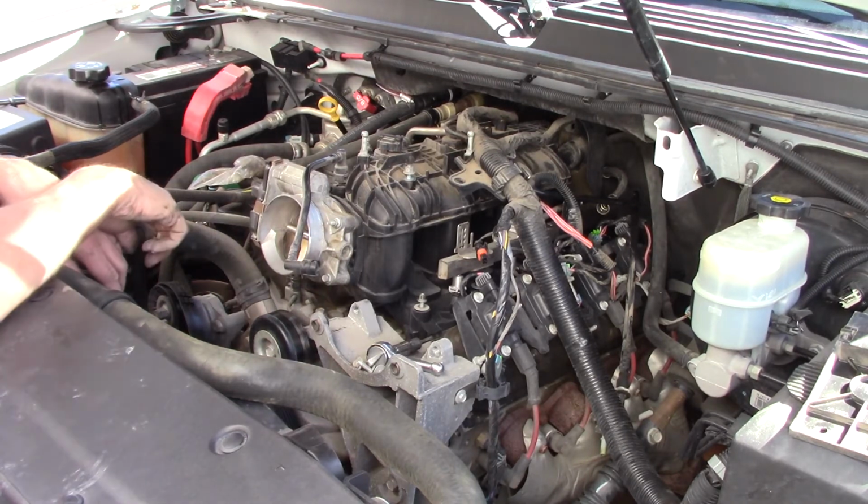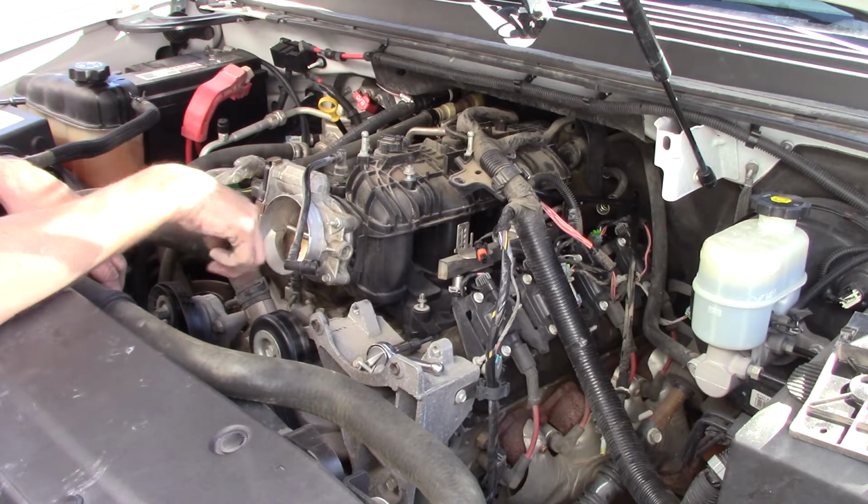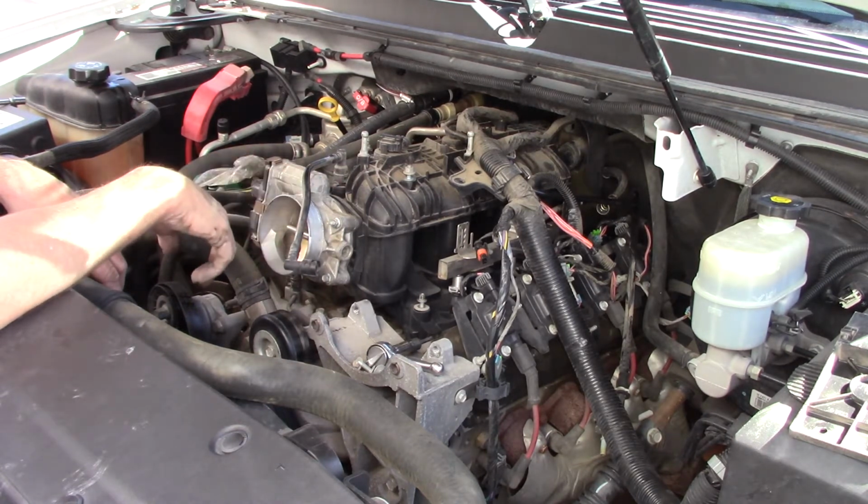I sort of told you I was going to bring you back, and then forgot to hit the start on the camera. I did take my air hose and blow out around everything once I got all the injector lines loose, and I got the fuel line off, which actually didn't have a lot of pressure on it. So it tells me I'm losing something. She does run just a tad rough, cold, sometimes at an idle.